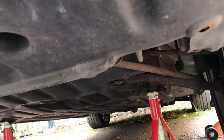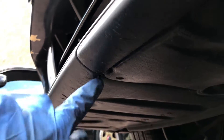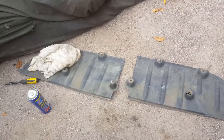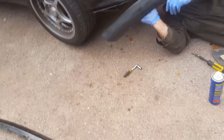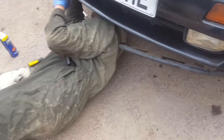And we are going to embark on taking this little bit off. We've got a couple of bolts here, and we're probably going to take this light off as well. So here we have Pugwash undoing all the bolts — he's already taken off the bolts beyond the tray, which you can see are in two pieces. He's having a bit of difficulty getting off the bolts that are holding the actual lip to the bumper, as there are quite a few snapped or rounded-off bolts.